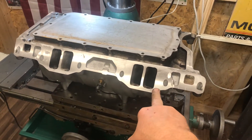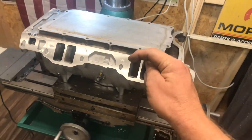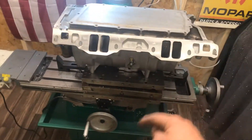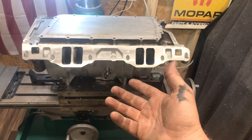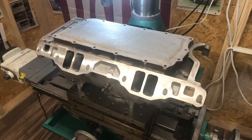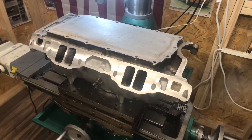This is a short 8-inch runner inside of here. And if you remember, this truck with factory stock Magnum heads — 192 — with only a Mopar Performance 062 valve spring upgrade, that truck made 336 rear wheel and 403 torque. That was pretty good for a Magnum head.